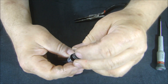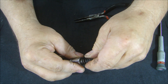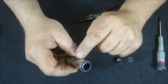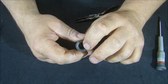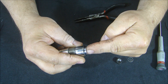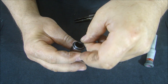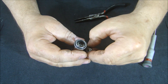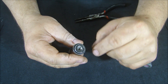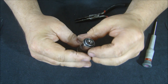Then you have your spring that goes back in the lifter. As this pumps, you can see how it sucks oil in, then sucks oil inside. As this works as a pump, the bottom check valve shuts off. The cam goes and pushes up on the lifter, compresses that, pumps oil through the metering plate, then comes through the head of the lifter where the push rod resides. The push rod sits in here and as it pushes, it acts as a pump — pumping oil up to the top of the engine. That is how a lifter works.